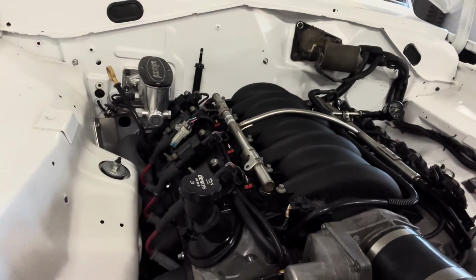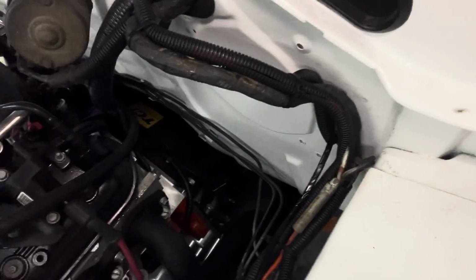I might go to 3.9 or 410s or whatever they come in with the Ford Explorers. So yeah, got that Turbo 350, the LS. Castlemaine Rod Shop, they actually make a fair bit for converting LSs to Valiants. They do a starter motor relocation because it's too tight where the steering box is on these. So as you can see on the driver's side, it's pretty tight. There's not a lot of room in there. So the starter relocation is down there.